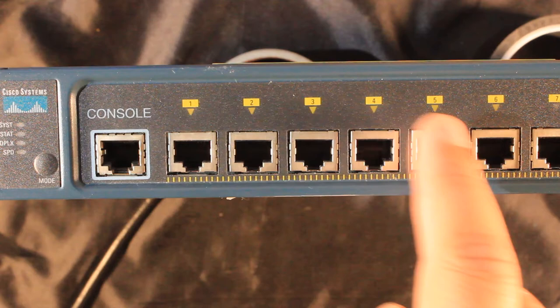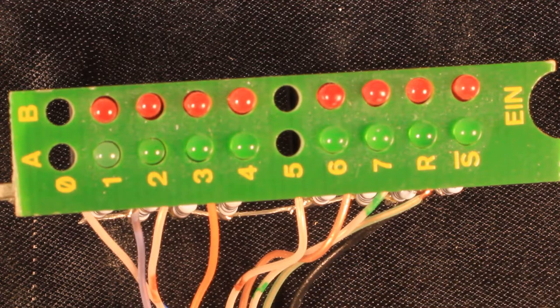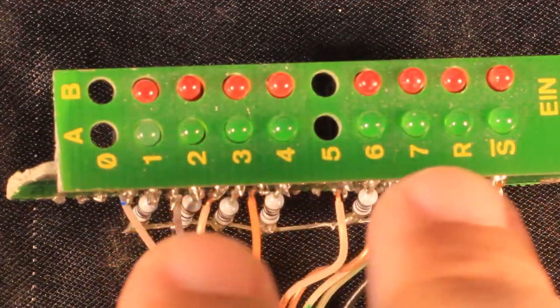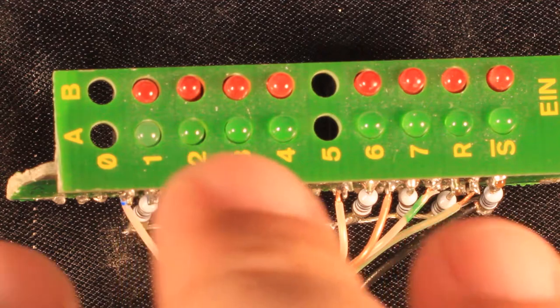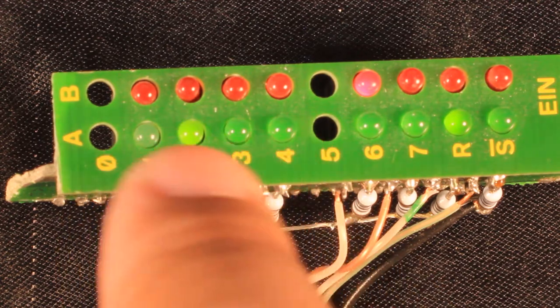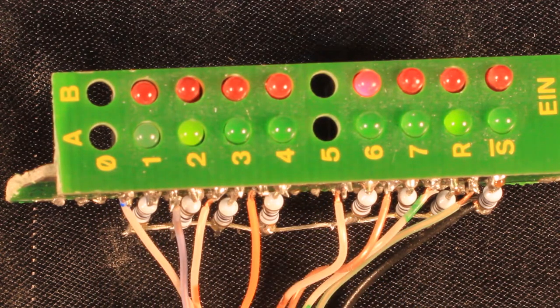As you see, all the LEDs just instantaneously turn yellow. If I attach the switch to the serial console with the Cisco rollover cable, I still see nothing on my terminal. I have attached this serial LED blinking light thing so that I can at least have minimal feedback on what the serial port is doing. But there is absolutely nothing — these two transmit and receive LEDs should be blinking, and they are clearly not doing anything.